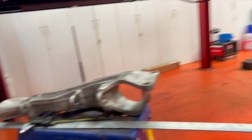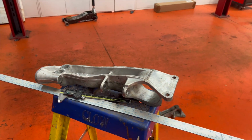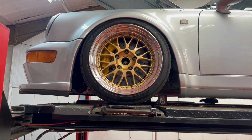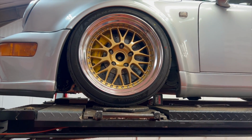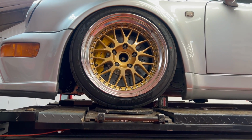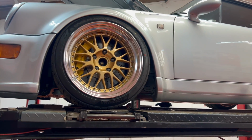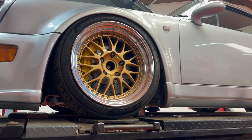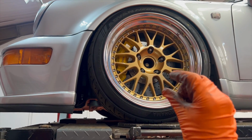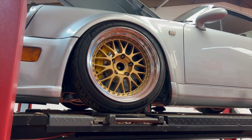It's a plan called undo everything we've just done. Pretty much, yeah. So we're going to put these back on for now. I'm going to put my sensible hat on, and before fabricating loads and loads of stuff, I am going to ask Jay to kindly put the 964 versions back on. We're going to stand the wheel up ever so slightly from its previous 3 degrees to 2 degrees. And we're going to accept that it's going to have terrible looking wheel fitment for now, but what it will allow me to do is do an alignment on the car, go and drive it, see whether it fixes this bad handling trait of being pulled all over the road, because it will have 15 mil less scrub radius because the spacer has been removed, and it will have slightly less camber. So yeah, that's the plan.